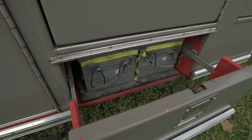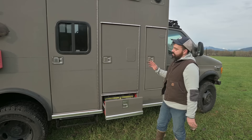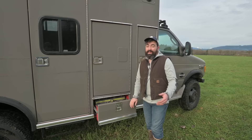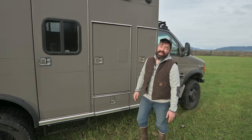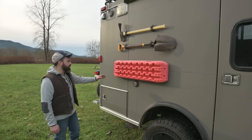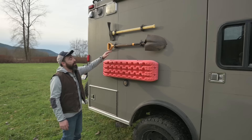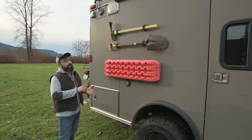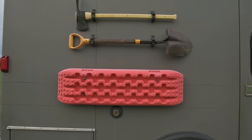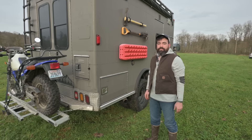Down here is our battery box. We have two big 8D deep-cycle marine batteries — 230 amp hours each — tied into the solar on the other side, and also charged by the truck alternator. Being an ambulance, we have two high-amp 130-amp alternators, so we've got a lot of power on board. We can just start it up, idle for 10-15 minutes, and recharge our whole system if we need to. These are recovery mats — we have two that clamp to the side. When you're on private forest land in Washington, you actually have to carry a spaded shovel, a Pulaski, and a five-pound fire extinguisher or they'll kick you off, so we mounted ours on the side so they were visible.